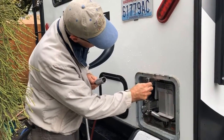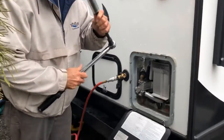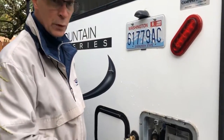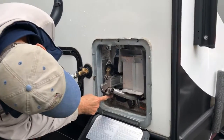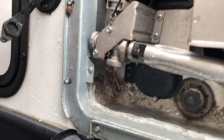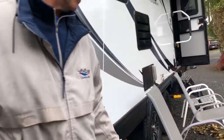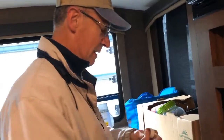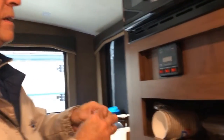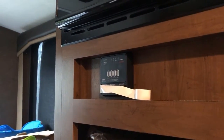Close the temperature pressure relief valve and that is drained and ready for winter. There's also a switch inside the water heater compartment for the 120-volt AC — turn that off so you don't accidentally power it up with no water in it. Then go inside and tape over the water pump switch and the water heater switch so nobody accidentally turns them on.